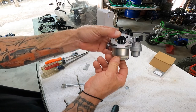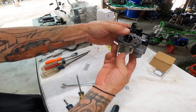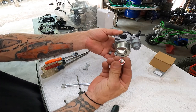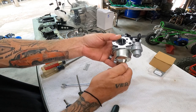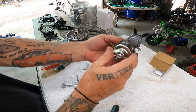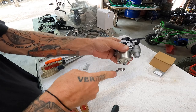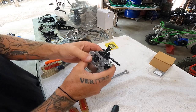When I put the bowl back on I'll figure out where it's going to sit in relation to the motor — I want the drain to kick to the back side so you can access it. If you got it turned around you're not going to be able to get to it. Make sure your seal or gasket's still on your bolt for your drain plug on the bottom of the bowl. Make sure it's all the way in the groove, then just tighten it up — you don't have to get crazy with it, just good and snug. That's it — that's how you change your jet.